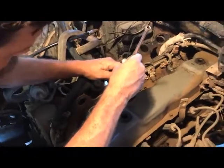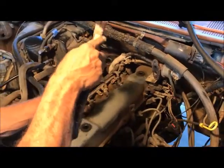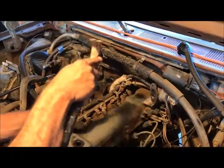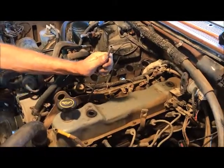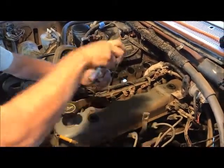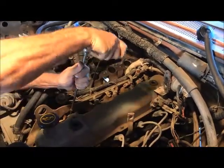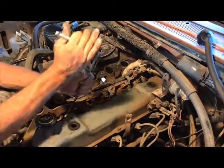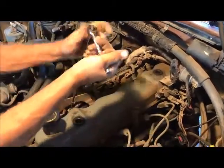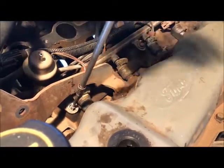As I turn it backwards just a little bit, I'm going to give a tap just to try to get it to bite, and then we'll try to pull it out. As you crank — remember you're loosening because it's grabbing the threads and pulling it out backwards. You're not going to try to tighten it in there; you're going to loosen it. Let those threads work backwards until it grabs the threads of the bolt. If you look down inside there, you can see the threads are coming right out.